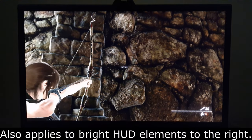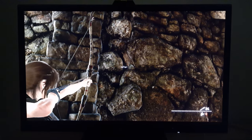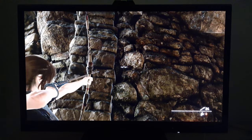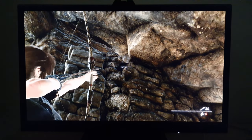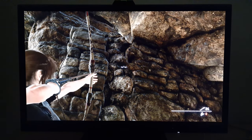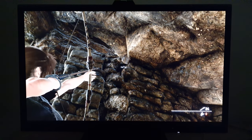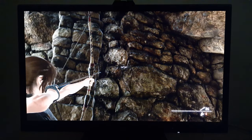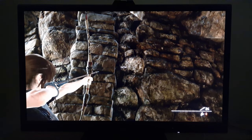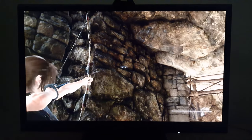Well, again, that per pixel illumination is fantastic. So the bright crosshair there with a really dark background, there's no haloing, no blooming around that crosshair, per pixel precision. So there is an excellent range of closely matching dark shades. This monitor also supports true 10-bit color, and that is actually used under HDR. If you're using HDMI, by the way, it still uses 10-bit color, but it's going to be using dithering because it has HDMI 2.0 and it can't support the 10-bit color on the monitor itself. It'll be using GPU dithering. That does work very well, but if you want to be having everything done on the monitor itself, use DisplayPort, and the array of these closely matching dark shades is excellent.